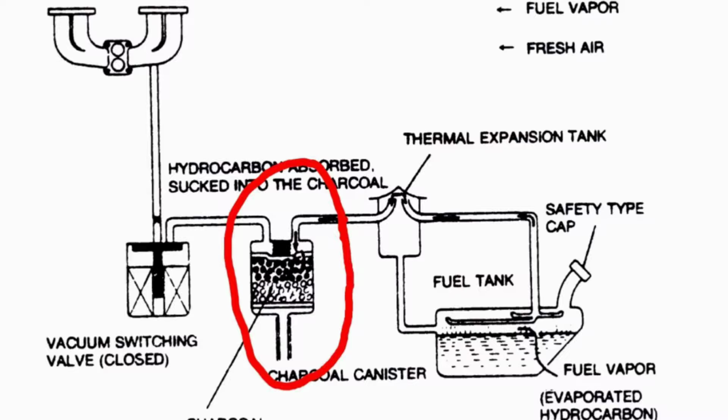the evaporative system. And in your evaporative system, they are, in short, pulled through your fuel tank, through some vacuum lines and so forth, in through your intake, and through a charcoal canister. The charcoal canister, which they would pass through first. Once they pass through it, they go into your intake and they're reburned. So your car reburns them, so they're not wasted.